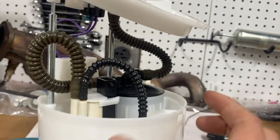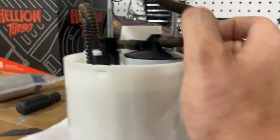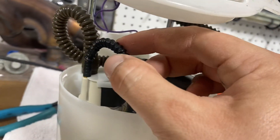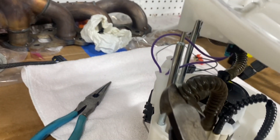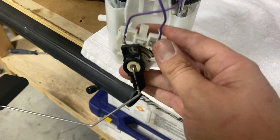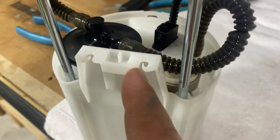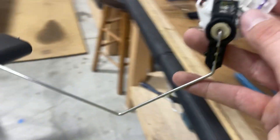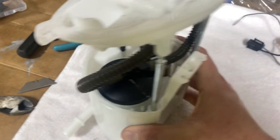We removed the wiring. From what I've seen in the instructions, this hose that goes from the filter up to the top will stay, but the other two will come off and be replaced. I wound up pulling the fuel level sender too, just so if I'm wiggling stuff around this doesn't get bent. It's just one electrical connector, then you unhook these two purple wires from these little clips - there's a tab you press down and it slides right out. I'll set this out of the way so it doesn't get damaged, and then we can proceed with separating the two halves.